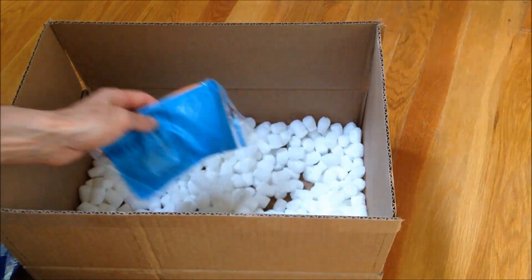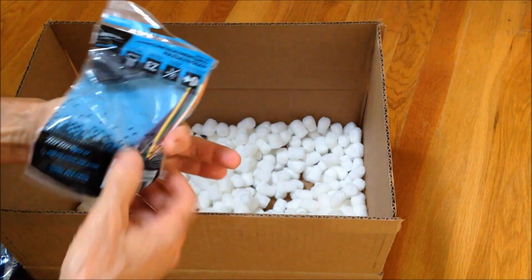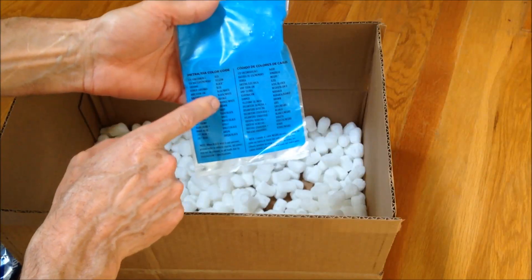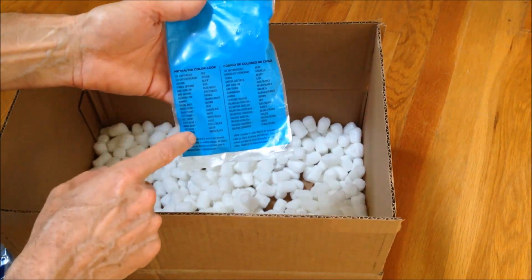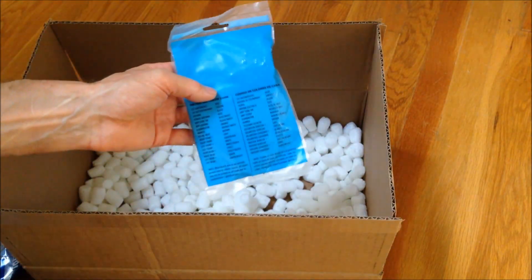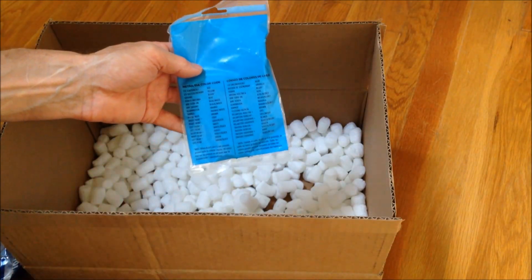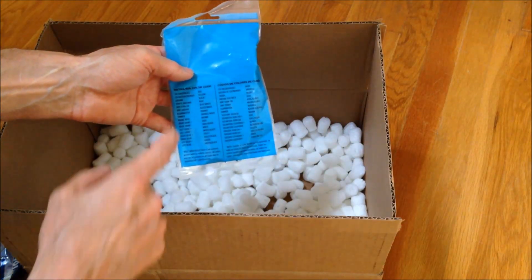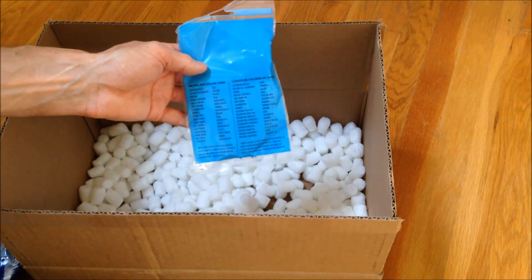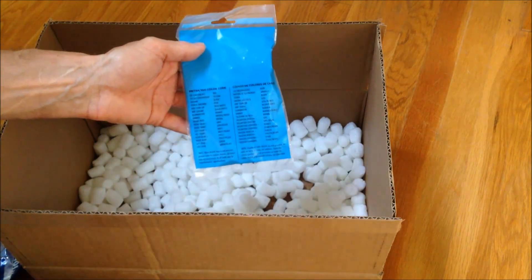Lastly, you get your OEM adapter. This OEM adapter has your different color codes, and on the back side they match up with the different codes describing the functionality of each wire. If we open up the box for the Kenwood, I'm sure we'll find the matching colors or descriptions for all the different wires coming out of the back of the stereo. The idea is to match wire-to-wire the particular item coming out of the stereo with the OEM harness — that's really all you have to do.